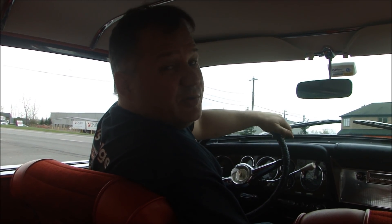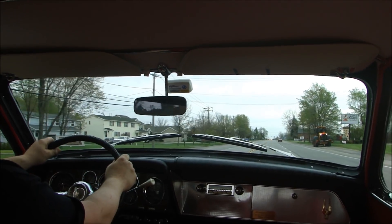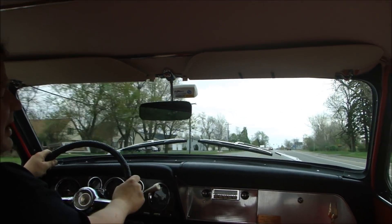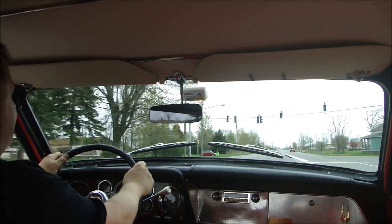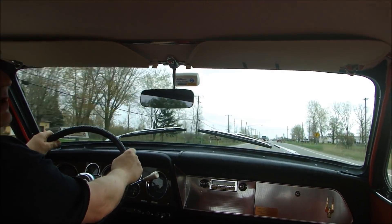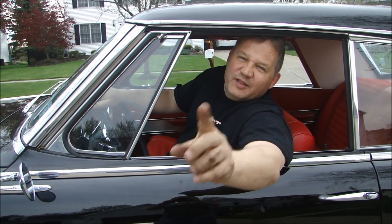Alright, I'm going to get on the road and on the floor, and we'll see what happens. It's got a two-speed transmission, so at 55 miles an hour it's going about 1600 RPM. At 60 miles an hour I'm cruising about 1700 RPM, right in the torque range. The car rides and drives like a dream — runs awesome. Thanks for stopping by Pete's Garage.